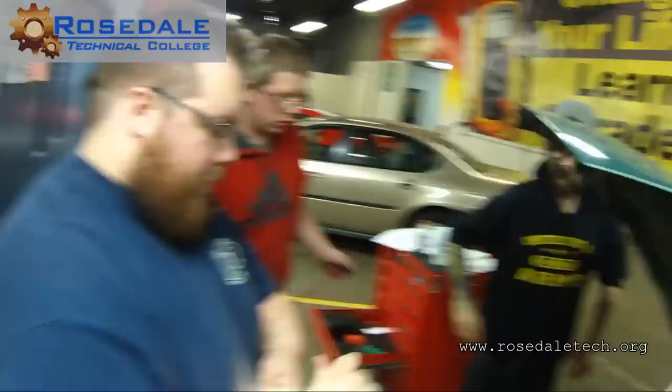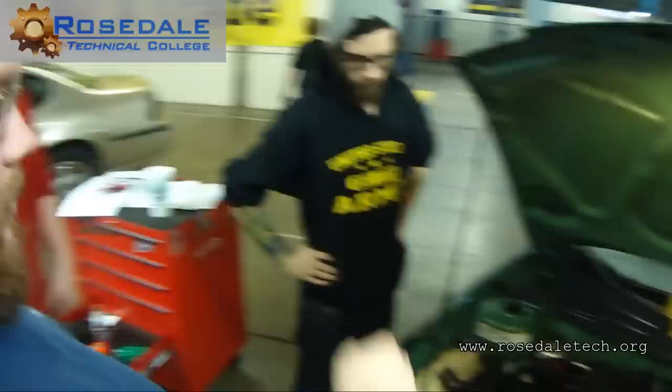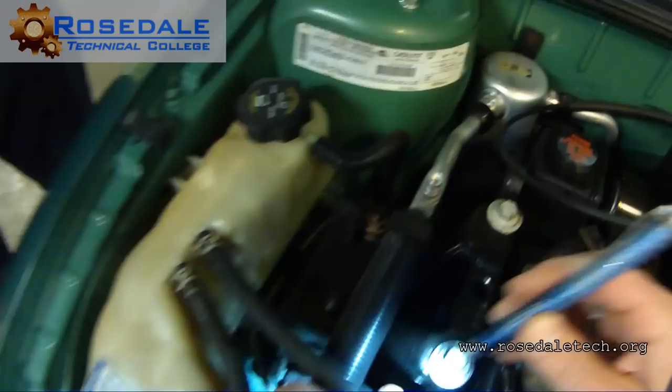What do you guys think? Where are we at? I personally don't know why, but I think the male connectors are loose or messed up. Just right at the connector itself? Yeah, like sticking straight out. Because whenever I tried to plug it in, it started going, but it was still real sloppy. Like I could wiggle it around. Can I see what that connector looks like? Was someone in here? Yeah, these pins look like they're really spread apart.